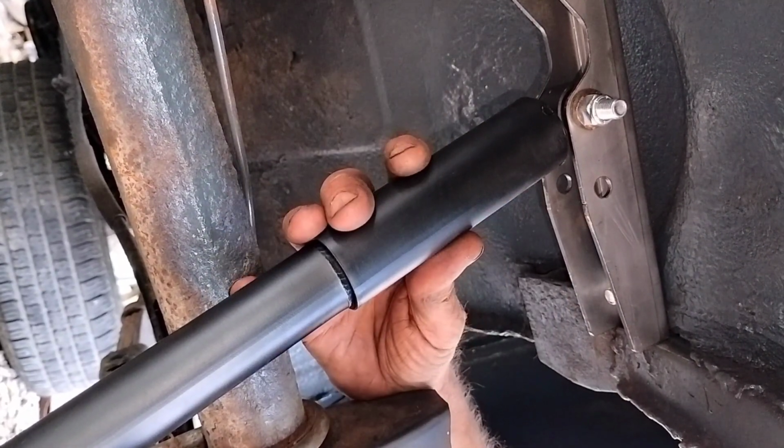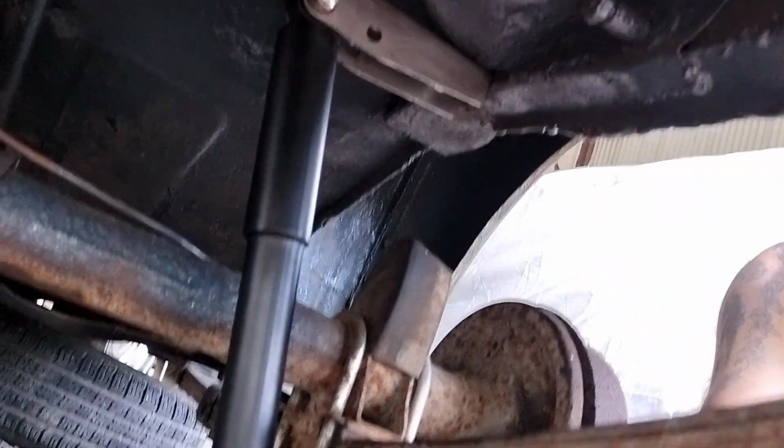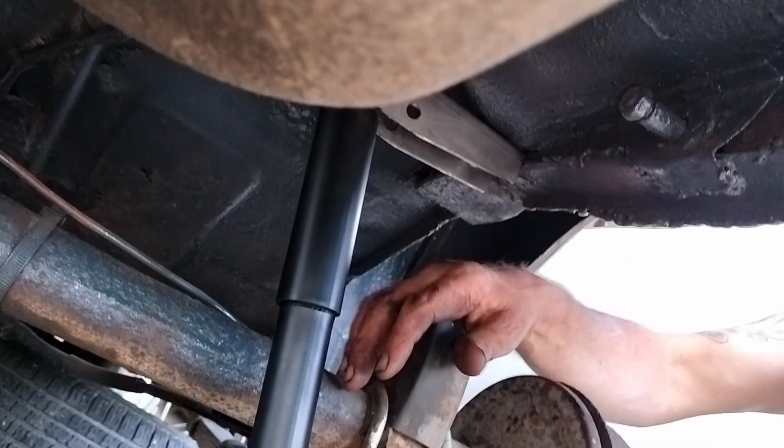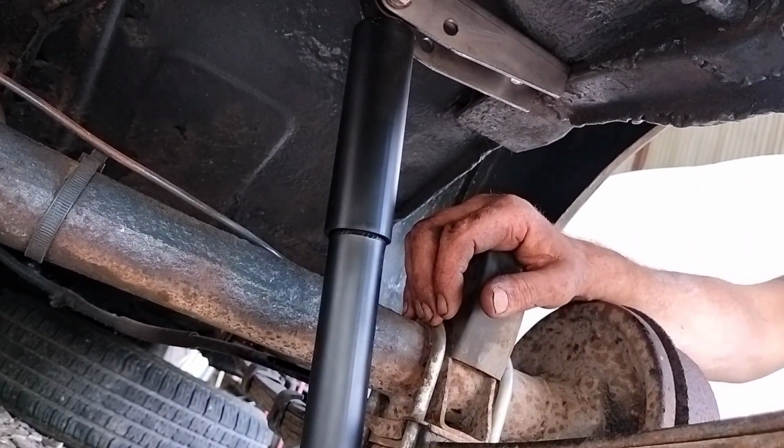We try to get the profile of this oil damper very vertical, and we've gone on the longest stroke of the damper, so it's the most extended, so we've got more travel when we're going on these terrible bumpy roads we're suffering from.